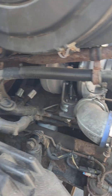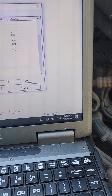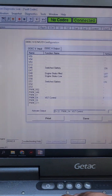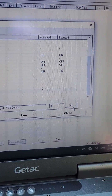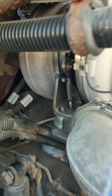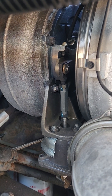Right now it's set to 7 because my ignition is on but the truck is off. I want to show you the position of the actuator before I change it. If I set it to 50 and confirm, it should move — and there we are. The achieved value is 49, and as you can see it moved — it moved half the travel it's supposed to travel.